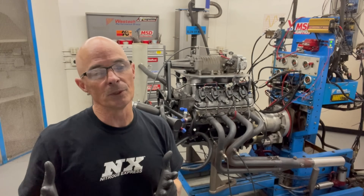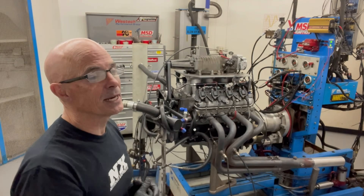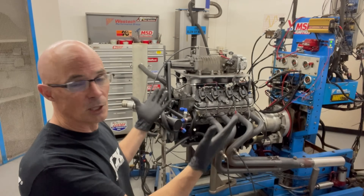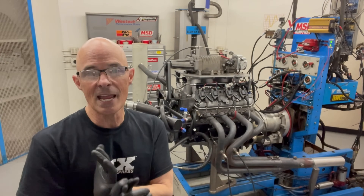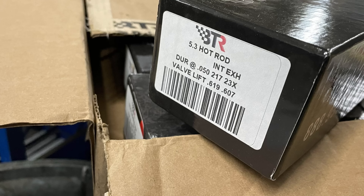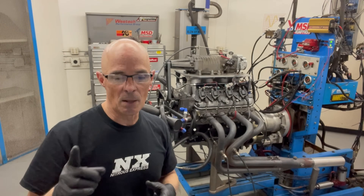Now I want to replace the camshaft. We have a Truck Norris camshaft in it with the 4.8 — it seems to work pretty well. Yes, it is a turbo cam and also an M90 blower cam. But I want to put something bigger in it because we don't have a whole bunch of blower to play with. All we have to do is make the naturally aspirated combination more powerful, so we're going to replace the Truck Norris NSR cam with a hot rod cam. We know from previous testing on the 5.3, the hot rod cam makes more than the Truck Norris cam.